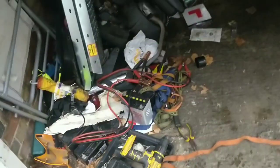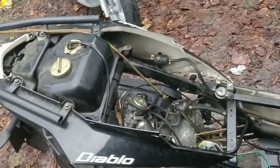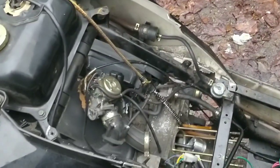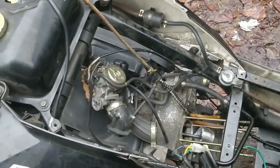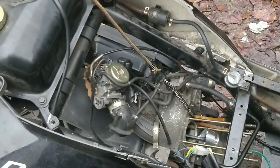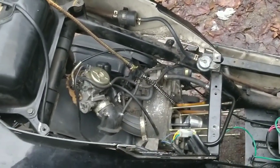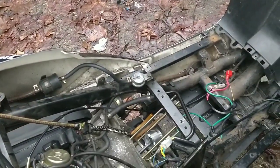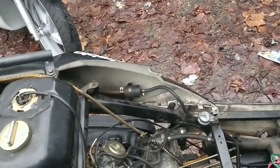Buying the actual rings and piston only now costs close to how much a rebuild kit would have been, but no one could tell me what kit this was, and I don't want to keep spending 40-50 quid on ones when people say yes it's the right one and then it's not. Apparently this is the newer engine that should have a fuel injection module, and I argued that and said, well no, this is completely standard setup, which it is, guys. And they said, well, yeah, maybe that engine was released with a carb for a very brief amount of time, which is why it's quite hard to find the right bore. You may find that a bore from another Lexmoto might fit, but again, it's not worth the hassle. Anyway, I've got the parts I need to reassemble the bike with its basic piston, new rings, and a bore that's looking slightly touchy, but should be okay.